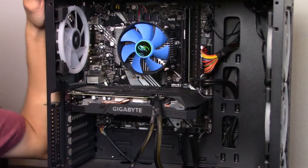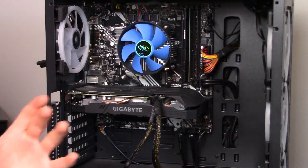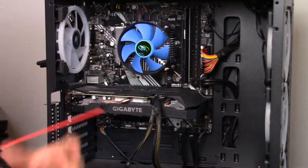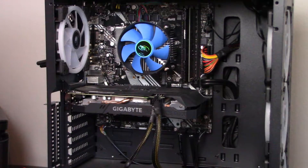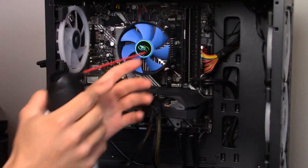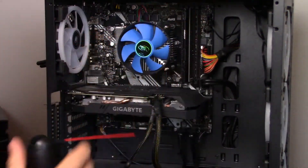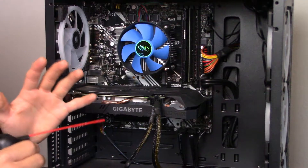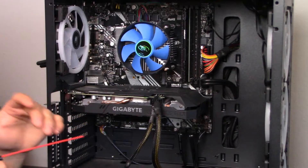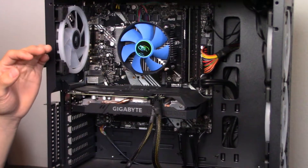It's pretty self-explanatory — just spray down pretty much all your components. While spraying, you actually won't be able to get all the dust out in some spots. That's why if you want to get more depth, I recommend you take off some of your components for a really deep clean. Eventually I would recommend doing that because over time more and more dust builds up in small areas around your graphics card, your RAM sticks, and similar components. After a couple of cleanings, actually take off some components to get a better deep clean.